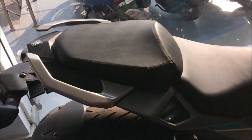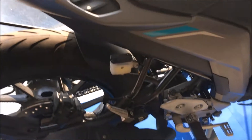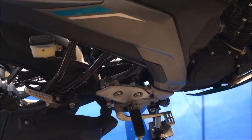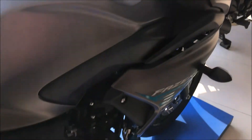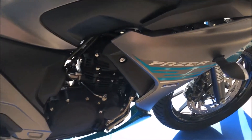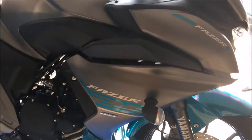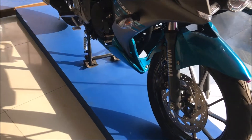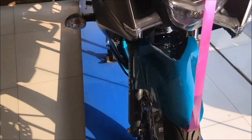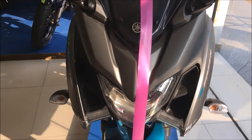The design of the fairing is like a wrap-around of the FZ250 and it's a really busy design. Coming on to the engine, it is powered by the same unit as the FZ250, which is an air-cooled single cylinder 249cc making a max power output of 20PS at 8,000rpm and 20 Newton meters of torque at 6,000rpm. There is an increase in weight and everything else is the same from the FZ.